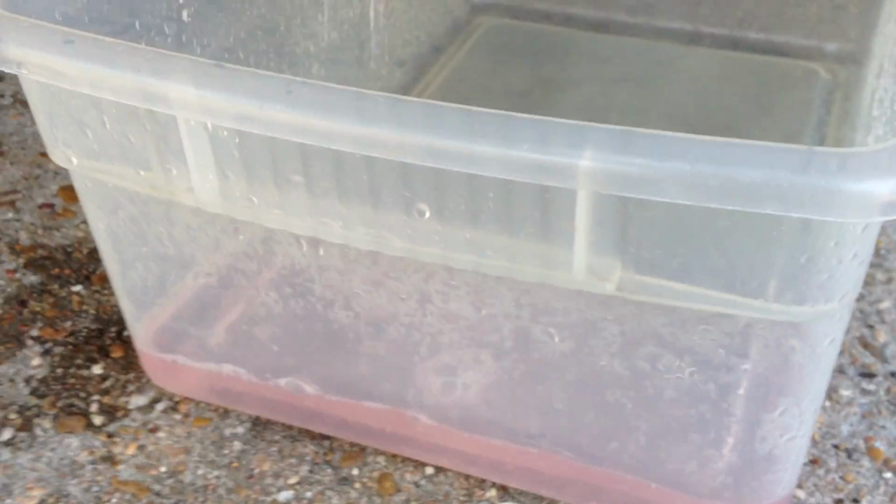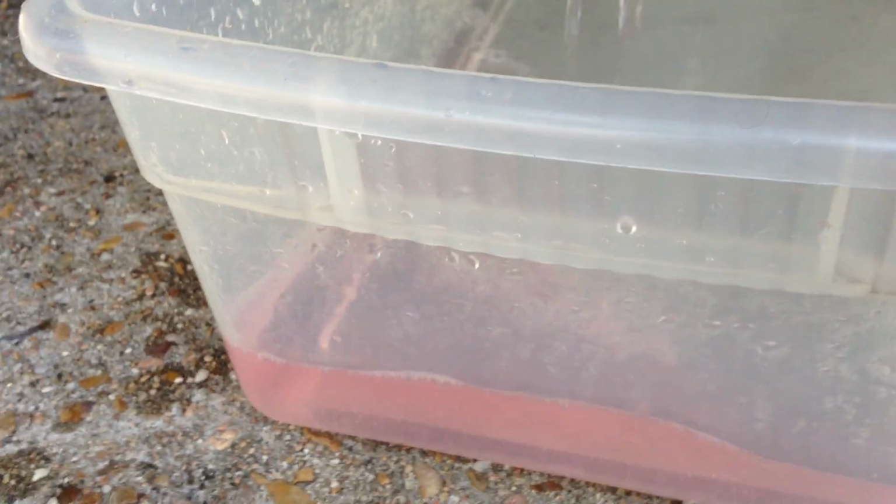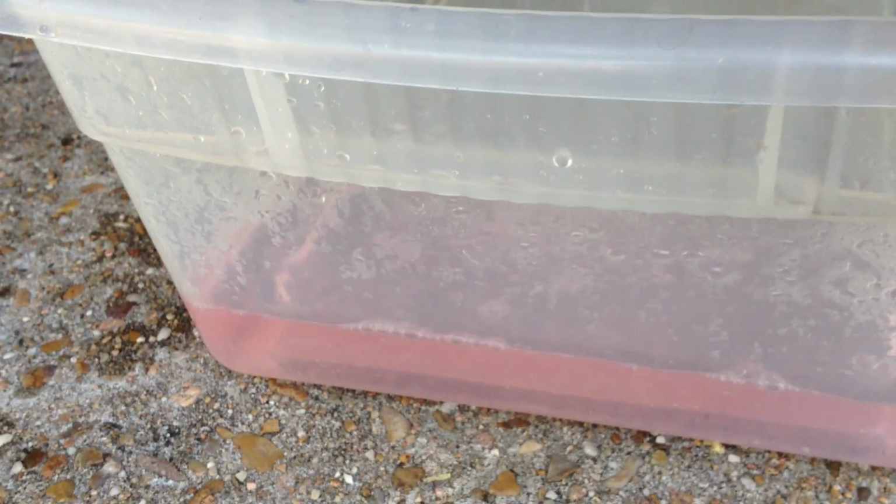It's not draining the full coolant, because there's coolant and water left in the engine block that you can't really get to. So again, this is draining the radiator. You would do this initially like this. Now, I've already gone through probably 6 gallons of distilled water doing this cycle, and you can see now there's very, very little coolant there. It's mostly clear. So I've essentially done what I feel is enough flushing of it.